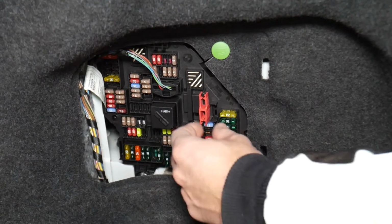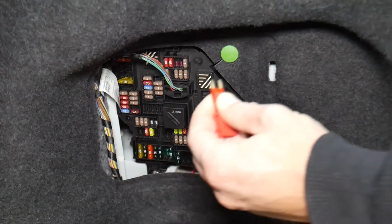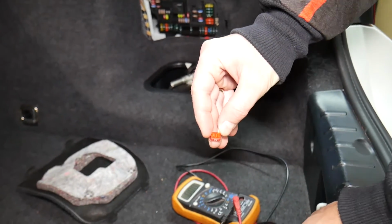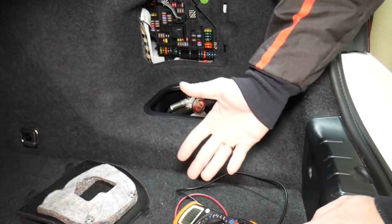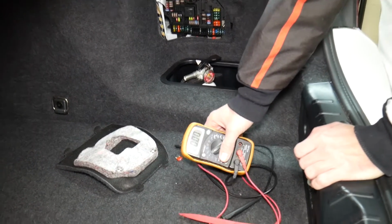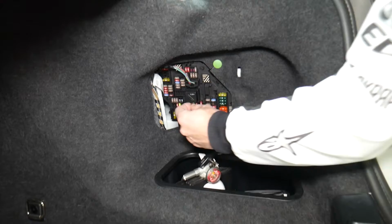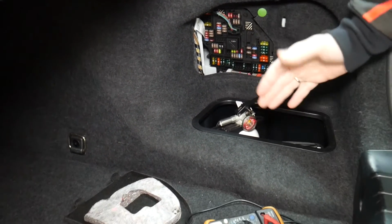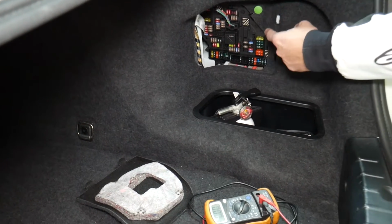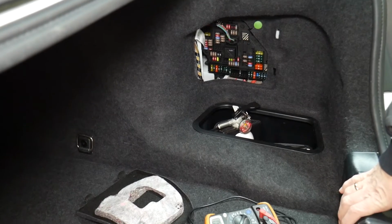Before we continue, let's explain quickly why it's always a good idea to test fuses and relays. Fuses sometimes are really hard to know if they're burnt or not. For instance, I'm going to pull one fuse here, and sometimes you cannot clearly see if they're good or bad. Let's say you think you have a good fuse, you put it back in and you end up having problems again, and you spend time, money, you buy parts, diagnostics, you pay for services that you don't need. You practically wasted your money. So all you have to do, check your fuses, that way you don't waste money. So always test your fuses, even if you think it's good. It even happened to us, and we work on cars all the time. Another thing, always test your relays. They're a little bit harder to test, but if you want to see how to test fuse relays, we will put a link in the description of the video below. We've seen so many customers that think they have a good fuse, they put it back in, they waste their money on parts and diagnostics that they practically do not need. So check out the link in the description below for how to test the fuse and how to test the relay as well.